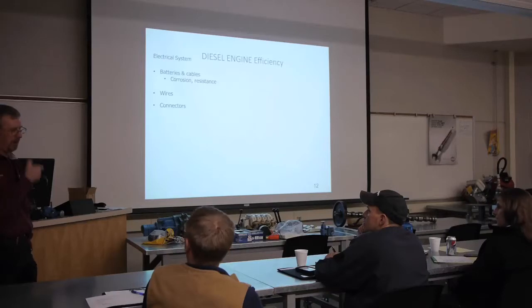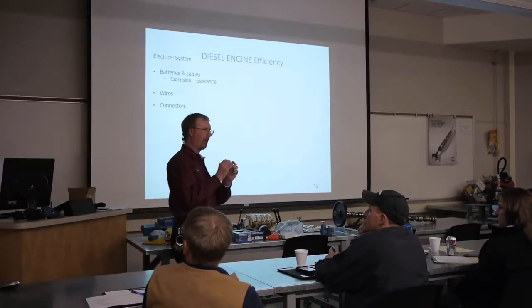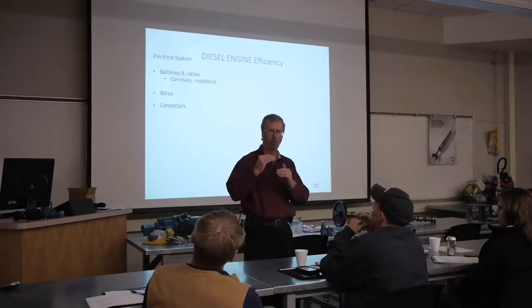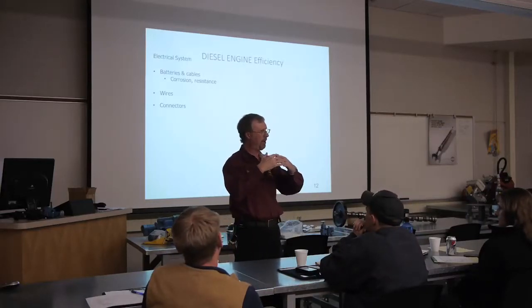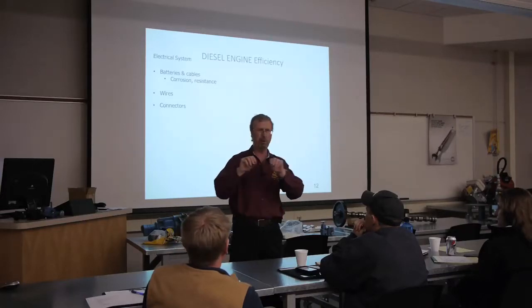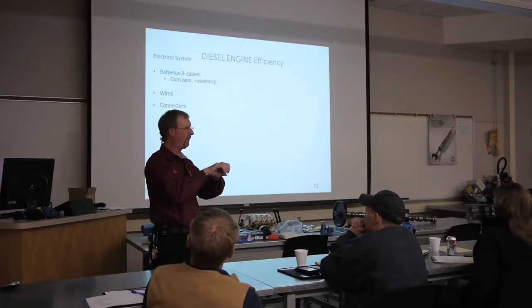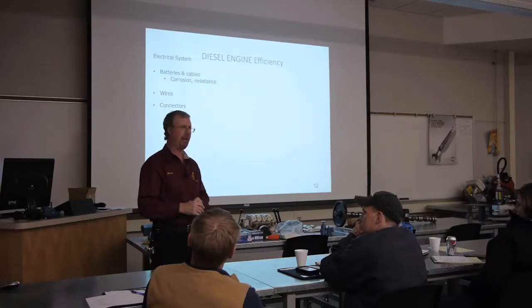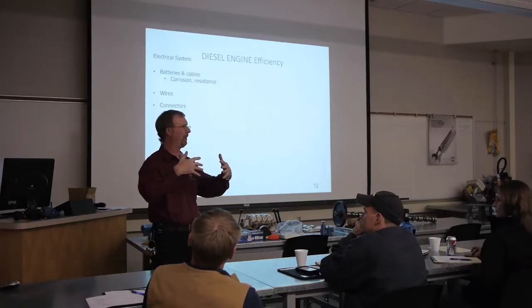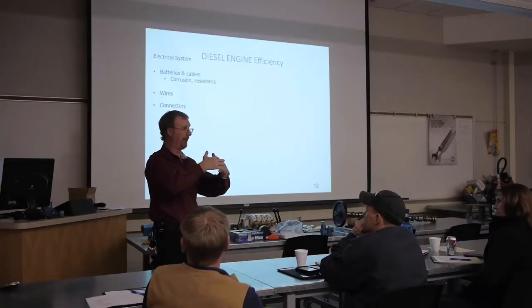Connectors. So there's a little strip of steel of various formulations on the end of a wire. Typically, there's a male and female. Well, they lock together, right? Well, the plastic piece around that is what we call a connector. The metal piece is the terminal, and the plastic piece around the outside is called the connector. Most of those have some type of a locking mechanism on them. Once we get them together, they snap over a hinge or whatever to kind of hold them in place.